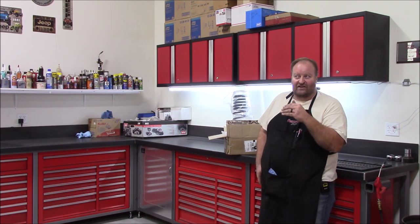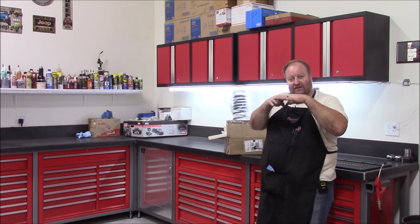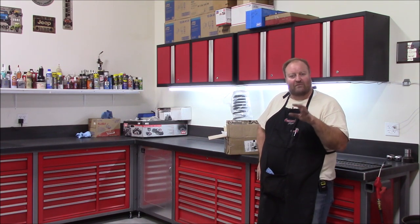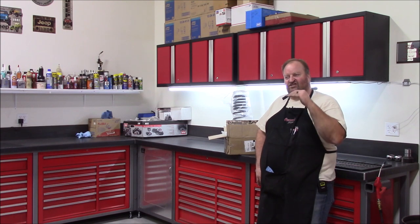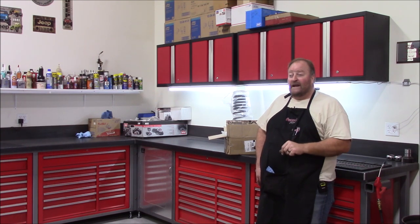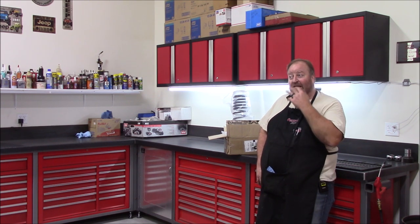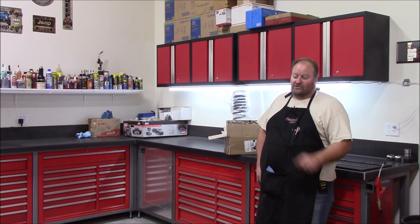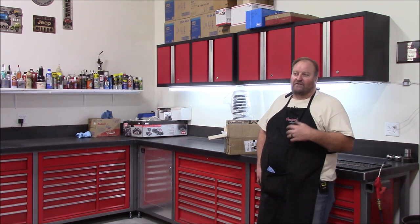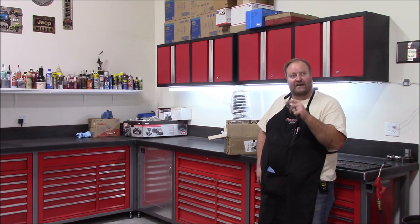And so I adjusted the front spacers down, which therefore put the front end up about 3/8. It wasn't much, like 3/8 of an inch, to get the nose just a slight elevation over the rear. And that's where it's been for the last 7 years and probably 90,000 miles. So looking back, I don't think I would do that again. I think I would put the proper springs under it, and if needs be, a spacer, and call it good.